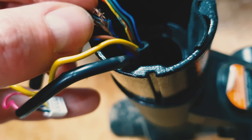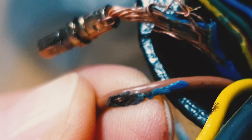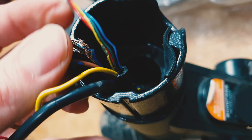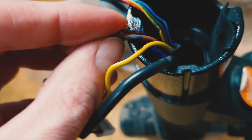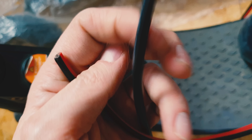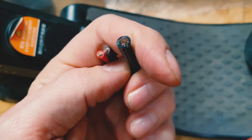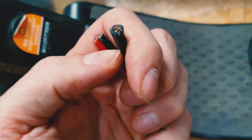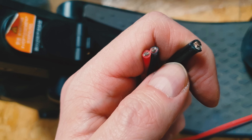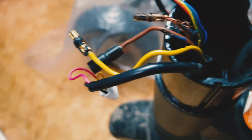I'm quite sure it happened because this blue cable touched the brown one, as you can see. Here we have some melted material and they touched together — this is what happened. Good quality cables, like those used in Xiaomi scooters, are covered by a nice silicone cover that can easily survive over 150 degrees Celsius, not some cheap material like this.